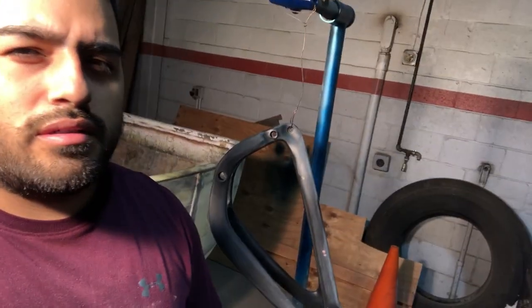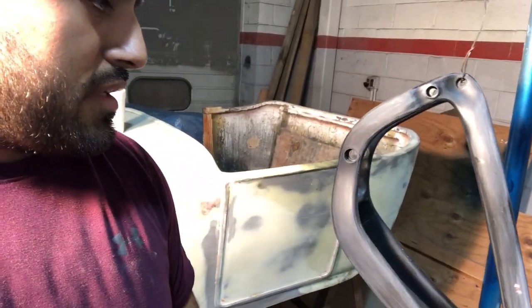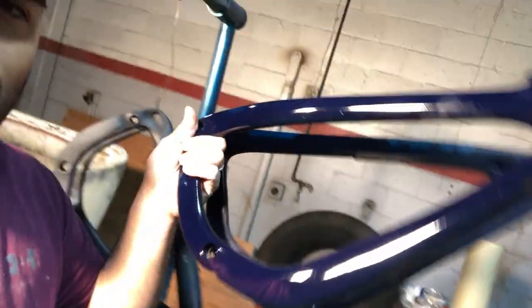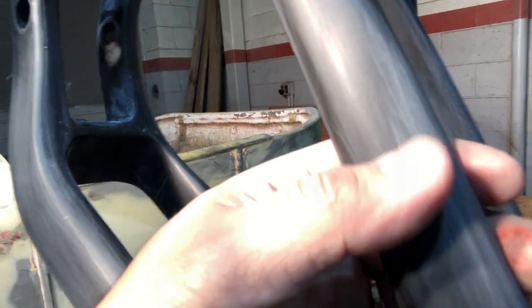So painting is being postponed until tomorrow. We finished sanding down, getting off all the lettering and Yeti graphics. We hit it with 200-250 grit and then went up to 800, smoothing it out. It's pretty smooth. This is a test swing arm that's cracked, but this isn't going to be the color — I changed my mind. We did have to fill some holes; there were a couple little scratches from rocks and stuff like that. All sanded smooth and it should be ready to paint tomorrow.